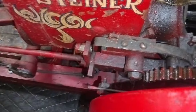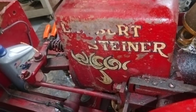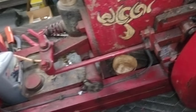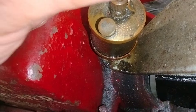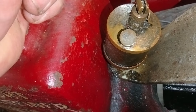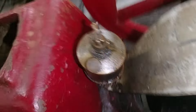It's a very simple system: you have positive and negative. When we close this and create a contact, it just grounds to the engine. Here we see a contact — it's actually the exhaust valve cam. When it touches, it's on; when it's off it's hanging in the air. This of course has fixed timing, it doesn't change. When the exhaust valve is open and this thing is freewheeling, it doesn't use any battery power — the buzz coil is completely disconnected, so it's not continuously firing even though the engine is spinning.